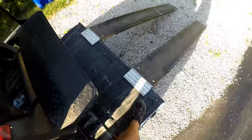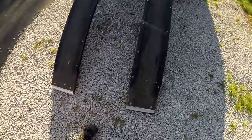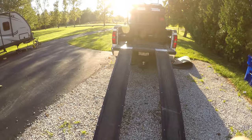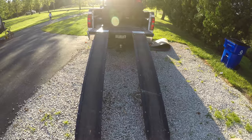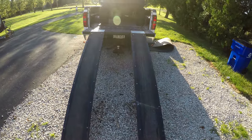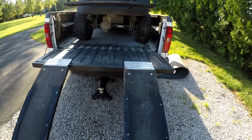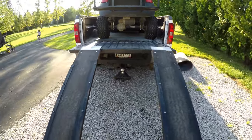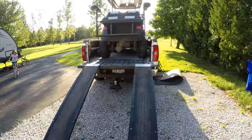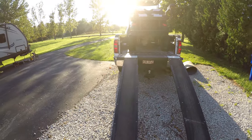For the backing-down part, it's extremely important that your ramps are in perfect alignment. I'm going to take this up and show you — after I got it up in the truck I actually hit the wheel well, so I have to reposition it. Typically I'm not driving it up and then immediately back down, so I just eyeball it to make sure we're in good position. I want the tire right in the center and I'll confirm as I'm coming down.